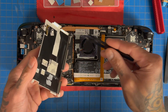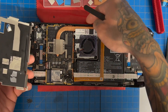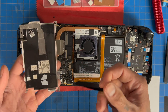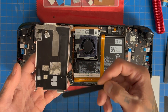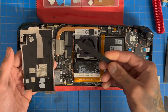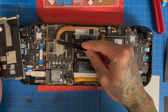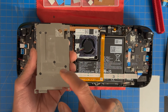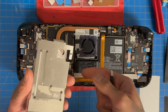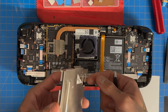Although they are not actively cooled, they are still tied into the system — tied into this heat shield, meaning they're touching the heat shield, hence these little pad cutouts right here. So what the thermal pad mod is, is to tie that system better together with our dissipating system, which is this heat pipe connected to the fan that blows hot air off the top, cooling the overall system. We tie those two together.